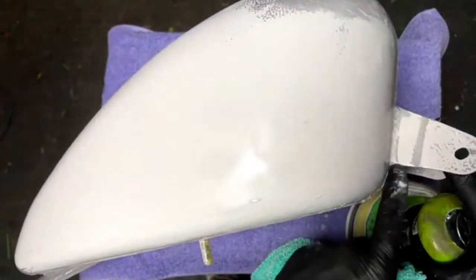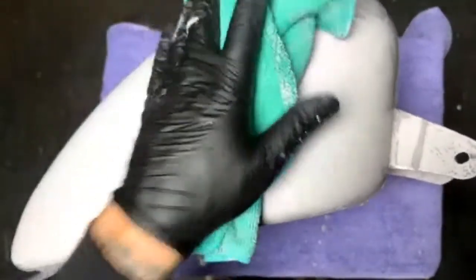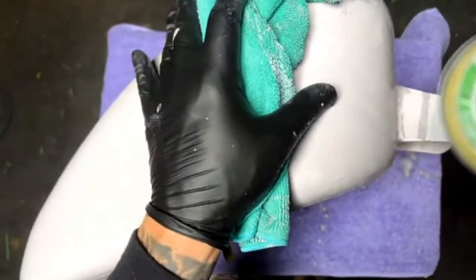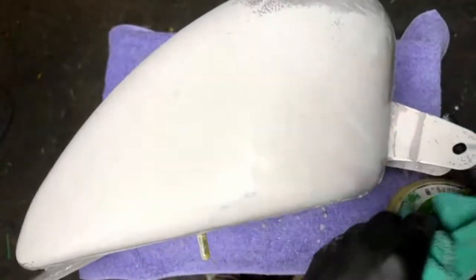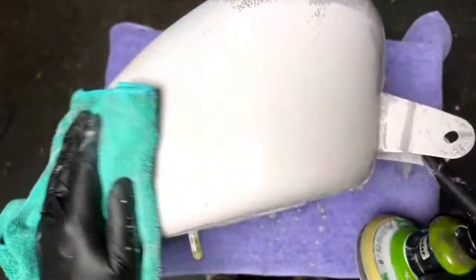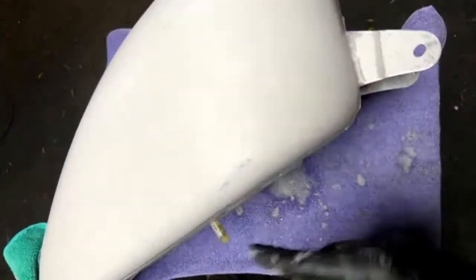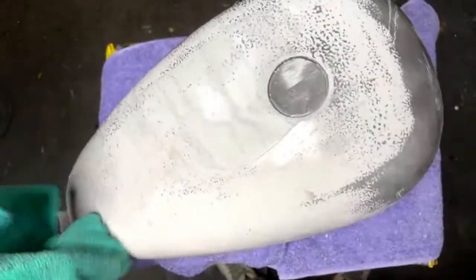You see right here, we have some sand scratches that may be deeper than what the thickness of the primer will provide. I'll probably hit that with the spray can primer, because there is a little aerosol spray can. U-Pol has a brand. It's just a one part, and you can use it, but just use it sparingly in spots here and there. You wouldn't want to use it as an overall. It's just not durable enough.